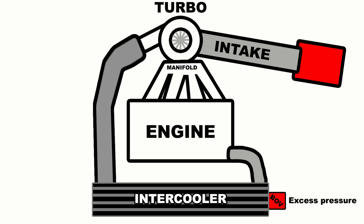A typical blow-off valve vents all this excess pressure to atmosphere — it takes all the pressure and removes it entirely from the system. It's not in the intercooler, not in the piping, not anywhere in the system. It's vented out completely, and this is what makes that iconic noise that we all know and love.